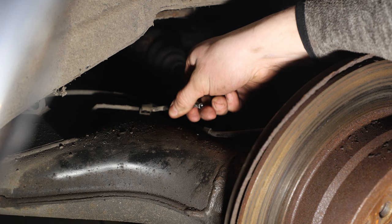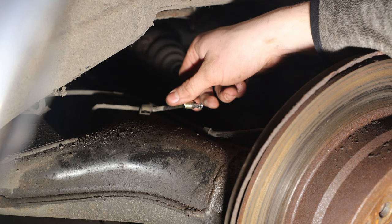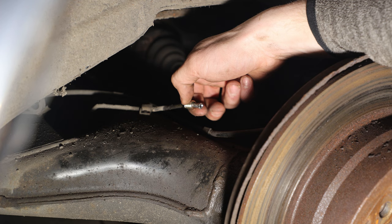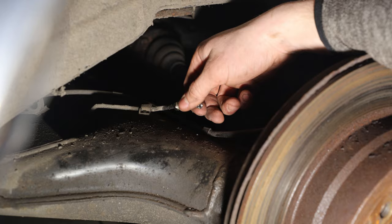I hate doing brake lines. I thought there was only DIN-standard stuff on Amazon, but this is garbage — it uses a double inverted flare and not the DIN standard that is common on European cars, so this is not the correct way to do it. But as I'm a bit in a rush I'm still going to use this. We might redo all the brake lines in the future, and even if I don't do it, the next person definitely will have to, because we're now at a point in the car's life where everything is just falling apart and brake lines start to corrode.